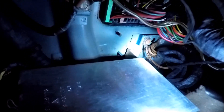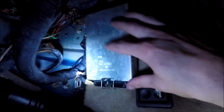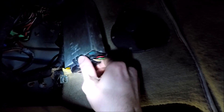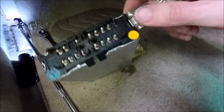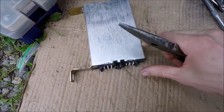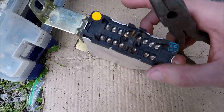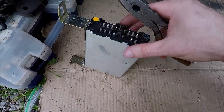The computer is right there, so I've got to pop that out and open it up. There's a bolt and a nut right there, and one right there — remove those, they're 10 millimeters. Then you need to remove the plugs and the computer is free. Use some needle nose pliers to bend all the little tabs out all around it, and then you can slide the metal case off the computer.